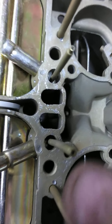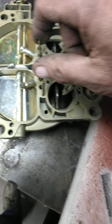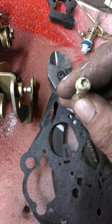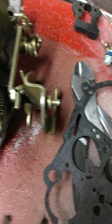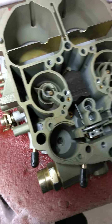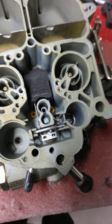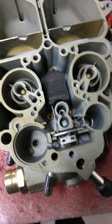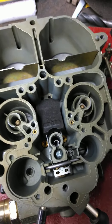I've got two different draft tubes — one side plugged and the other bent. Float level's off. I haven't even pulled the float yet, and this is just what I've found so far. I've got a parts carburetor over here, so I'm going to rob the vent tubes out of it, replace them with two good ones, raise that float up, and ditch all these beat-up screws. None of the screws were tight either — that's what started this whole thing. This is why I always say never put a brand new carburetor on your vehicle. Just because it's brand new doesn't mean it's right. Everybody be safe.